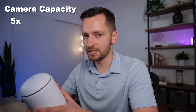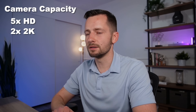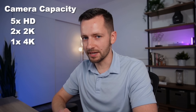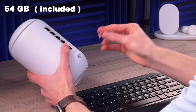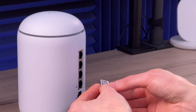It can run all the applications. For UniFi Protect, you're limited to five HD cameras, or two 2K cameras such as the Turret Ultra or G5 PTZ, or one 4K camera like their AI cameras or G5 Pro. Keep in mind the PoE port here is only PoE, so the G5 PTZ would need more power than this provides. A 64 GB micro SD card is included — it's a Western Digital card — which is good for NVR usage.